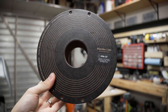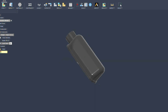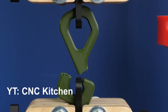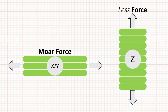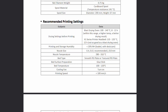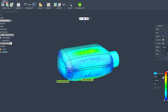The filament I'm using is PPACF, which is a carbon fiber reinforced nylon. To double check that this is going to withstand the boost, I ran a quick simulation. 3D printed parts are anisotropic — the amount of force they can handle differs depending on direction. The XY direction can handle more force than the Z direction, so I used the Z axis values for tensile and yield strengths from the technical data sheet. With a wall thickness of 6mm and pressure set to 14 PSI, the simulation shows a factor of safety of 15. Since I'm only running 7 PSI on the car, this is way over designed.